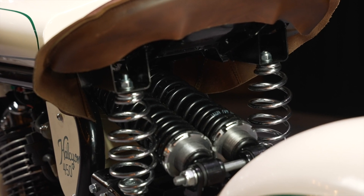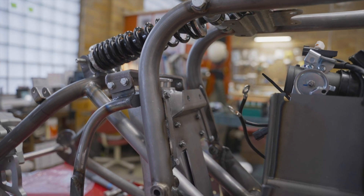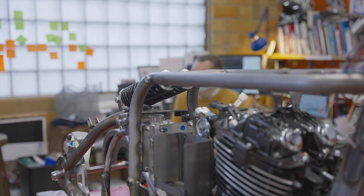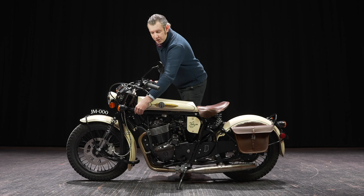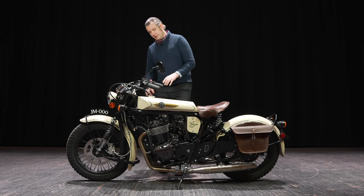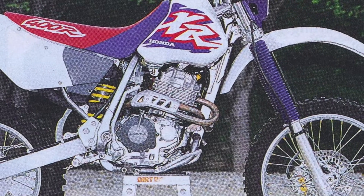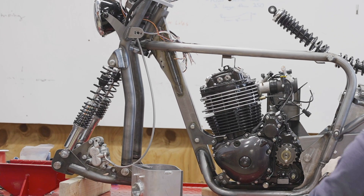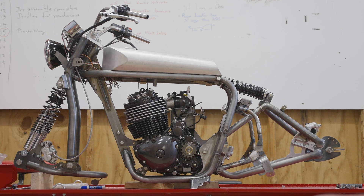Apart from the increased engine capacity, the frame, forks, and rear suspension have all been redesigned and beefed up for performance, comfort, assembly, maintenance, and ease of manufacturing. The 250 frames use one-inch DOM tubing and this frame uses inch-and-a-quarter DOM tubing. We've also changed from the pure featherbed frame like on the 250 line to a modified version, which allows us to run the two headers. This is based on the XR400 — we actually looked at how they did the frame — and we have a single rectangular tube that comes down the front so the headers can go between. We've also addressed areas in the frame that improve rigidity and assembly.